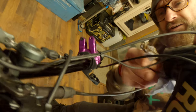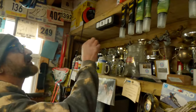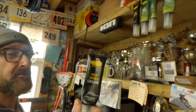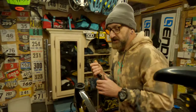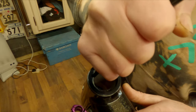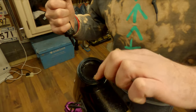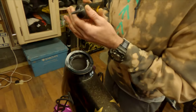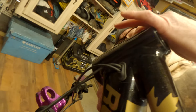Now some grease on here. For this I'm going to use Fenwick's high-speed grease — it's a nice light grease. Everybody gets carried away and puts too much grease in; you don't need loads, just a nice fine covering. Make sure you cover all the contact area. That's the top done, then the same with the bottom. That's ready for the forks.